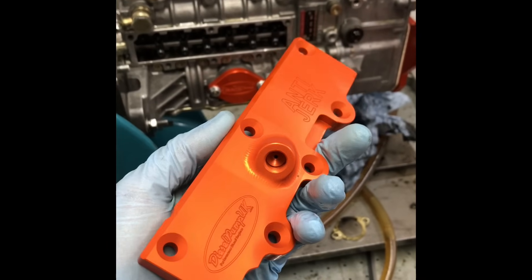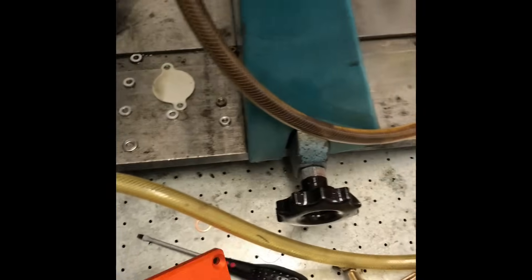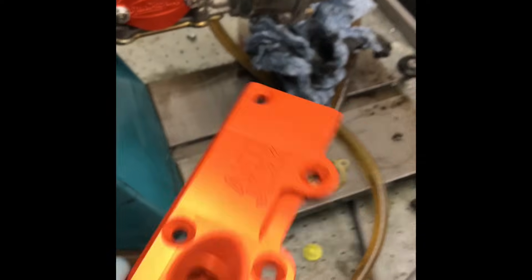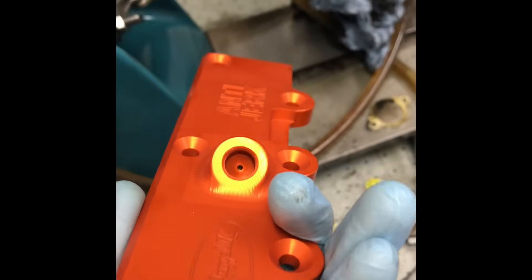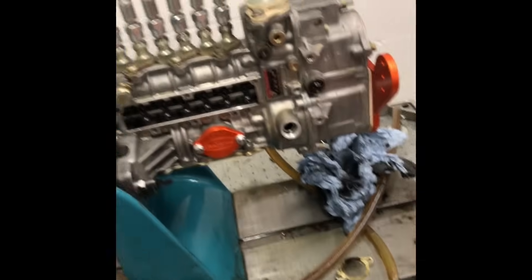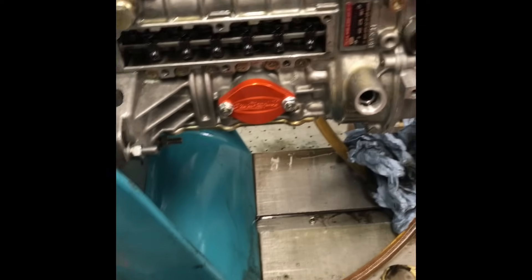Diesel Pump UK anti-jerk system. It has a very functional purpose, and that is to turn the original rack housing into a damper. It does this by injecting oil through a drilled capillary. Now when these come, if you don't want the anti-jerk system, you don't have to have it — it's not drilled all the way through. That pilot is nearly all the way through, and if you want to use the system, you just pop it through with the drill bit. You can also do it in different sizes to suit the severity of your issue. Now obviously we don't want to be pumping loads of oil in here, filling it up and causing all sorts of problems, because that would be senseless.